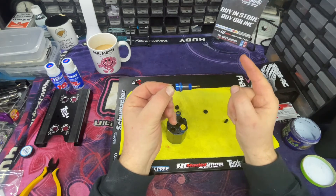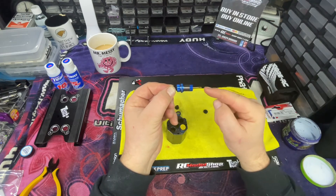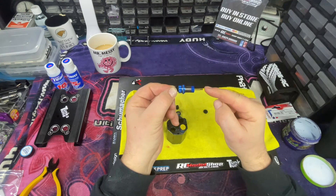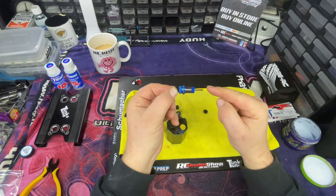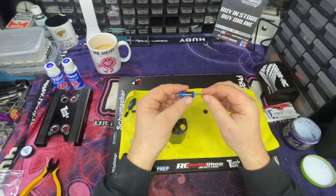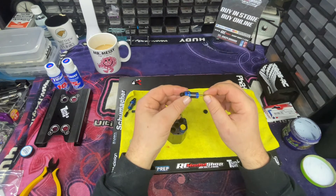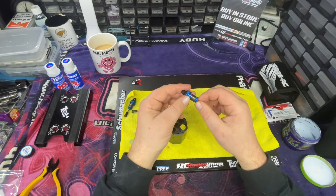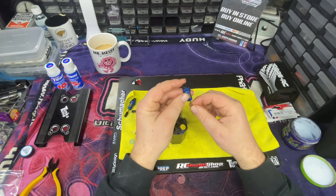This is going to be 100% rebound. The piston comes all the way out relatively quickly, which means they're almost like a dual-rate shock absorber — you've got damping both ways, then a little bit faster return or rebound. This is something I think is very good for carpet — the car has to settle back down quite quickly. Whereas on a harder surface, you want the shock to almost not be as damped.